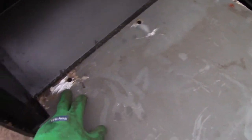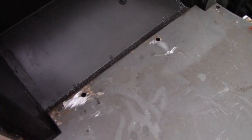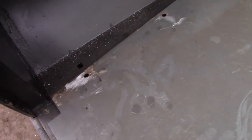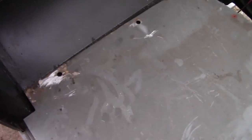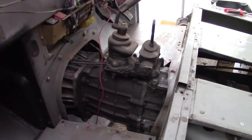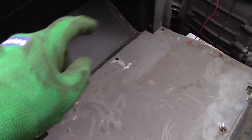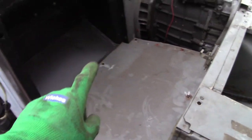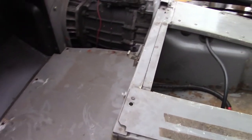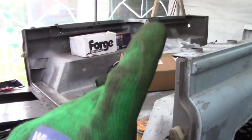I've got to drill a couple of new holes because the holes on the pattern bits don't quite meet up — that's just what you get from pattern panels unfortunately. It's a bit more prominent on the driver's side but that is a really easy thing to sort: a couple of quick holes through, get those bolts in to clamp that down, and obviously when I bolt all this back in I'll be putting a load of sealant in anywhere.